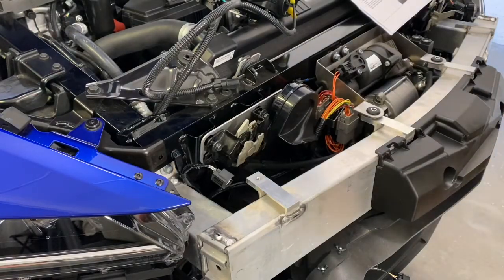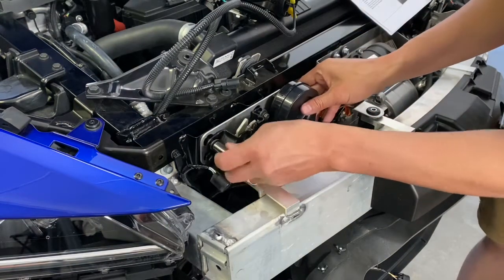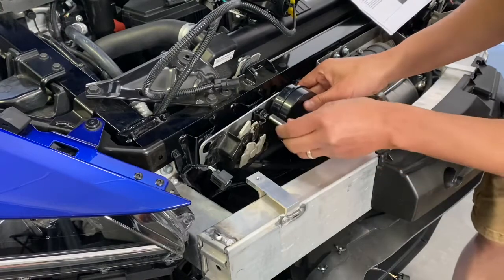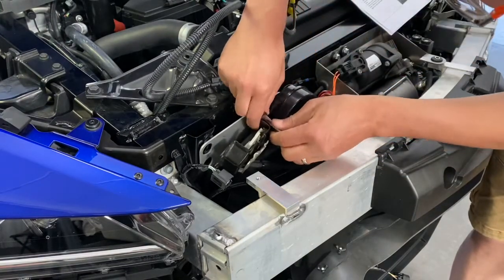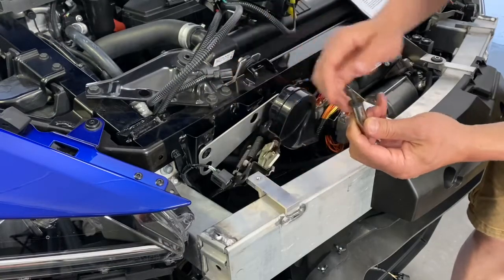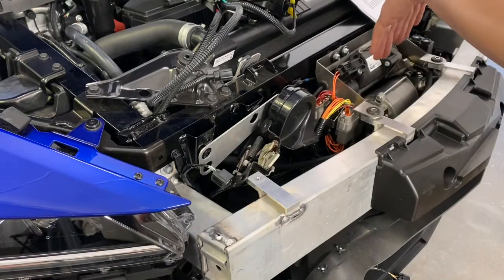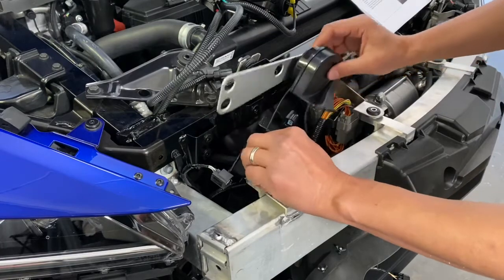There's a total of 3 10 millimeter screws that we're gonna have to take off. So we're gonna take these off. One of the things to note is this particular car that we're working on has the iLift system installed already. So it's a little bit more work to install it. If you didn't have the iLift, you can drop the horn in right over here and just slide it in here. But right now, from what I was told, okay, so let's get the horn out first.